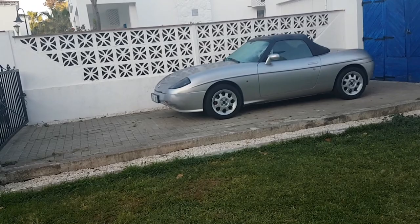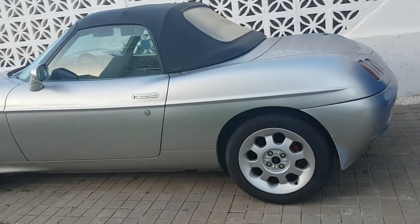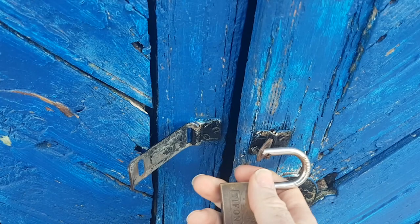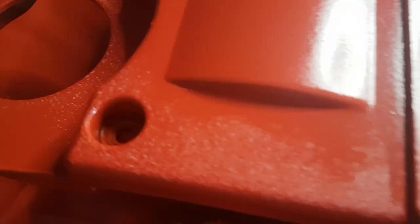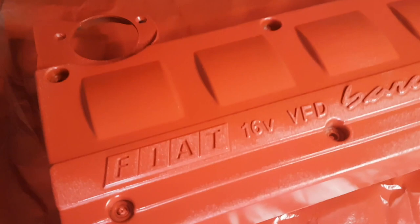Okay, that's the next day — let's go and check out the wrinkle finish and see how it looks. The car had to stay out all night, normally it's in the garage, but let's have a look. Actually, that is very disappointing. There's hardly any wrinkling and it seems very uneven. What I think I'm going to have to do is give it another coat or two, and this time rather than letting it dry naturally as it says on the tin, I'm going to try the heat gun and see if I can get a better finish.